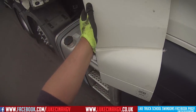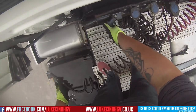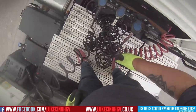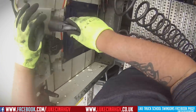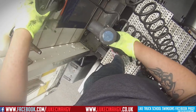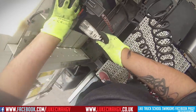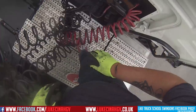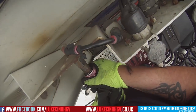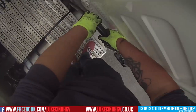Move the fender, climb up, and put the Susies back on. As I said at the beginning, I took them off front to back, so now I put them on back to front. I start with the far side first — it doesn't have to be done that way as far as I'm aware, it's just the way I was taught so things go in the right place. Then the white one, then the red one which is the airline. Susies are now connected.